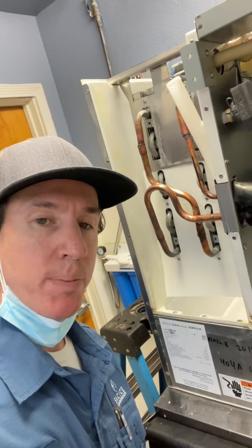I can't really get a good shot of what the bottom of it looks like, but if the top looks that bad, you have a bad evaporator and you need to have it replaced — or if it's old, use it as long as you can and see what happens. If you have low production and it's not making as much ice as it used to, check the evaporator — that could be the issue. Thanks for watching Ice Machine 411.